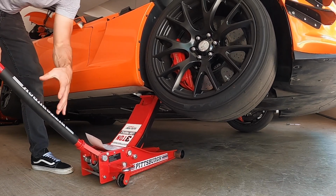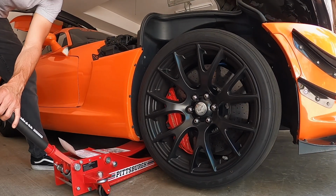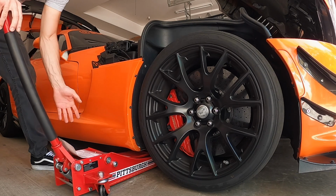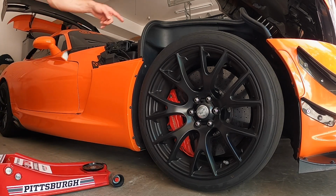That might be a little too slow, but it's okay. It's more of an emphasis on it, you know? And now the car's low. Look at that. I'm gonna go put this back, check the oil. You guys obviously have to make sure that when you check the oil, you're checking when your car's on a level surface. Otherwise, it's gonna be tilted forward or backwards, and you're not gonna get a correct reading with your dipstick. So we're gonna do that in 1 second, and then we'll be on our way to the shop to pick up that fluid I was talking about.